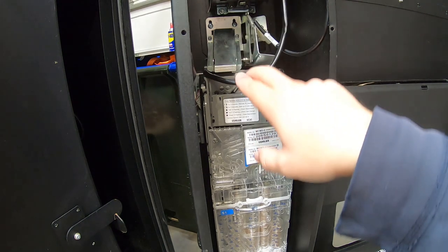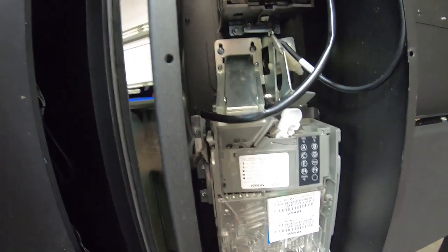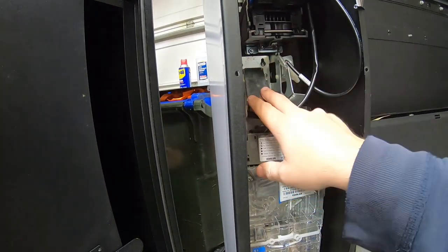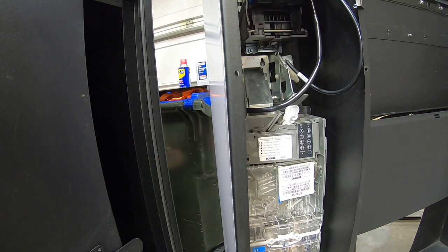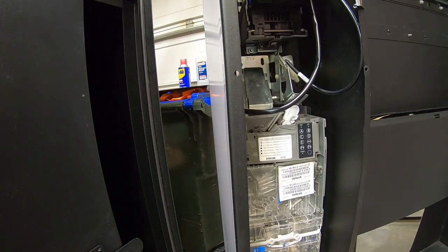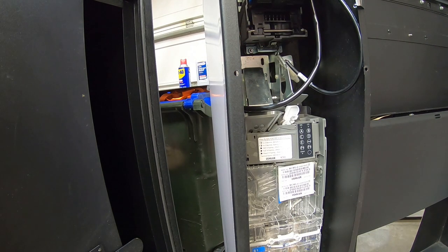What we're going to do first is remove this coin chute right here. Let me slide the camera in just a little bit closer. To remove the coin chute, I'm just going to take out these two screws right here — I don't know if you can see that very well. We're going to remove those two screws in order to remove the coin chute. Then once we have the coin chute removed, we should have access to the nuts and bolts we need for removing the actual coin mech. I'm using a regular Phillips head long bit to remove these two screws.